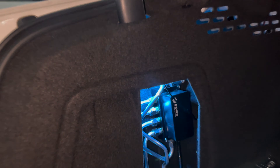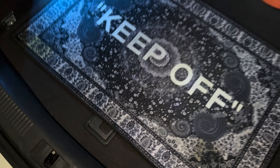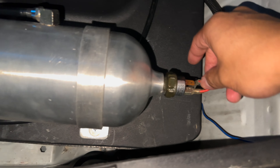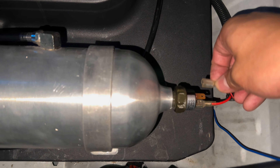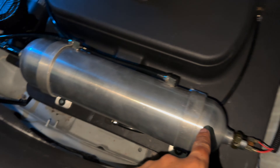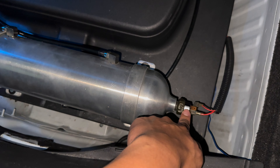The management system is called Down Air Suspension. Down Air Suspension is actually very similar to our first gen and second gen fitment management system. It's still using a mechanical pressure switch, which actually failed when he was backing up here. His pressure switch is stuck in an on state, so I pulled out the pigtail so we don't overcharge or break his compressor. That's one of the weak spots of this type of system.